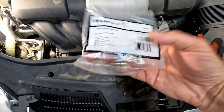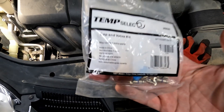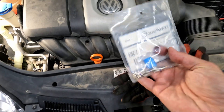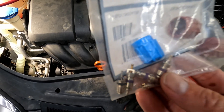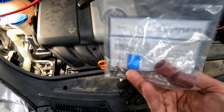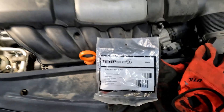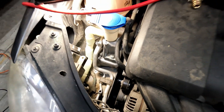Okay, back from the store. If you have a European car — Volkswagen, Audi — this little cap and valve kit from O'Reilly will actually work. It's got the exact purple-ringed European big bore Schrader valves that you need. This was about $15 at O'Reilly. They also have the smaller Schrader kits for about $5 to $10, so not too expensive to replace these Schraders.